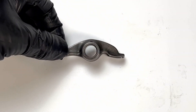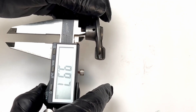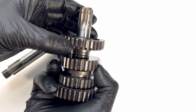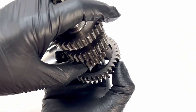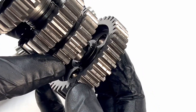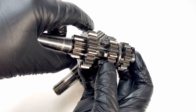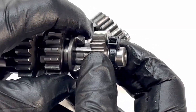Next is the bore of the rocker arm, with a service limit of 10.05 millimeters. To get a good reading, rotate the rocker bore with the caliper end inserted. This one comes in at 9.97, so it's still good. On the rocker arm assemblies, just make sure to repeat this procedure for both sides. Next, we're going to look at the transmission, starting with the gear. Look towards the center line of the gear teeth — worn-out gears usually have a shiny, polished-looking center line. Look for any chips on any of the teeth, and look for any wear marks on the engagement pins called dogs. Worn dogs will look sanded on their face, and the gears into which they engage will have a worn or glazed look like you might see on a brake rotor. Check that the gears spin freely without any run-out or wobble, and repeat these same checks on the opposing shaft.